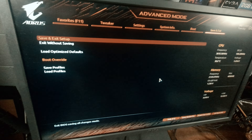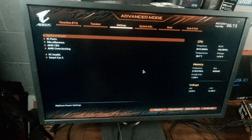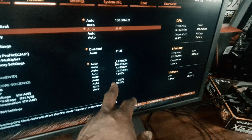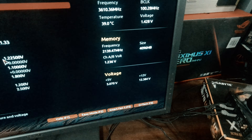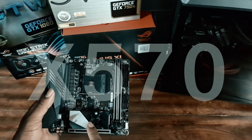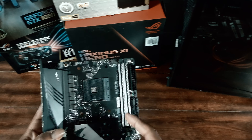Once I verified I could get a video out and everything was working at face value, I plugged in the keyboard and mouse, jumped right into the BIOS, and everything looked good — temperatures looked good, the cooler is working as it should, CPU is being registered correctly, one stick of memory is being registered correctly. I then connected a 500 GB Western Digital SSD from a previous setup, got into Windows, and everything looked good. I even connected to my home Wi-Fi to make sure there was no damage there — it connected perfectly fine and I was able to browse the web and pull up YouTube.